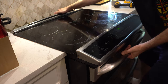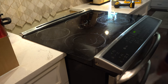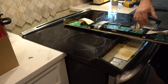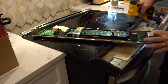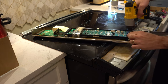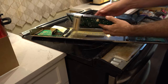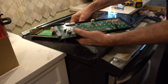This one's probably the easiest to get apart but has the most expensive part. I got the oven out, unplugged it, and removed a screw on either end to get the control panel housing off. Then it's just a matter of unplugging a bunch of stuff and unscrewing the plastic thing that mounts on the circuit board. You can see how the heat from those two double ovens — sometimes when we cooked bacon the control panel would fog up — so just after years of heat going across all this stuff, it's just ruined that touchscreen.